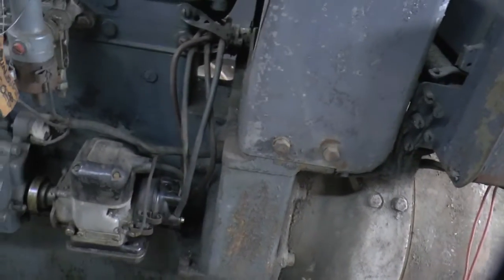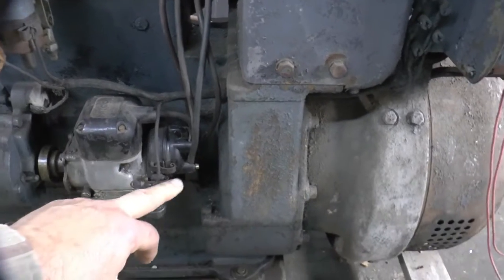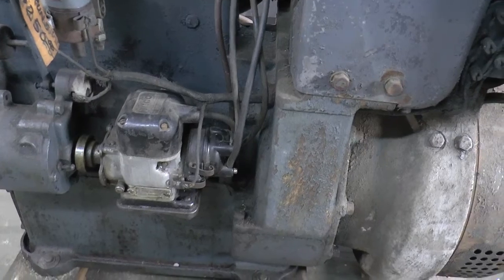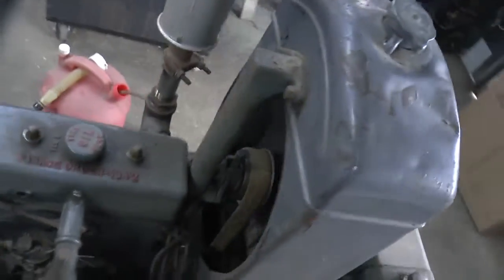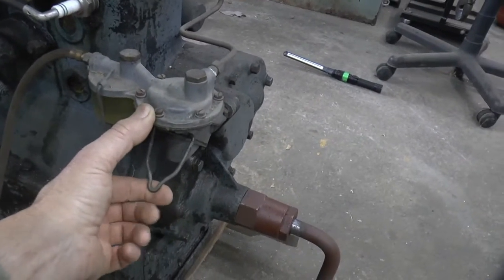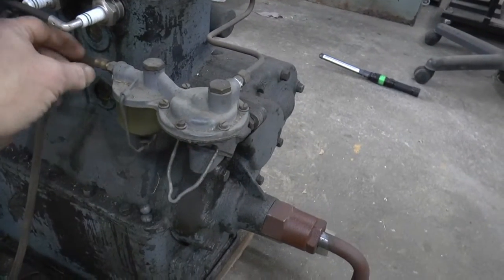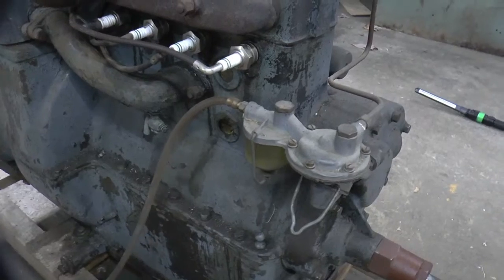Of course, it didn't run when we got it out, and the points were dirty. So I did clean the points, though they're not really cleaned very well — but enough that it runs again. I'm going to take it apart and do a better job eventually. We put a drip of oil in the fan bearing. The fuel pump has a hand pump to prime it, and that worked. Except this hose, which was pretty petrified — the one that was on there. When I pumped it, the gas just ran right out of it; it had so many cracks in it. So I found another piece of vinyl hose to put on there.